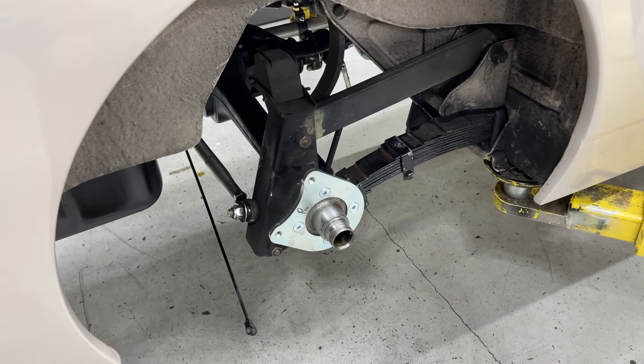This being the axle — once you bolt it all together, you need it to be deep enough into the differential unit. So what we have here is an extra-long axle that we sell in our catalog, and that solves the problem. It allows you to put a wire wheel conversion into a disc wheel car axle carrier and axle housing. That's a nifty solution, and I'm really glad we have these available.